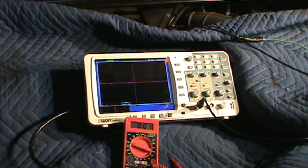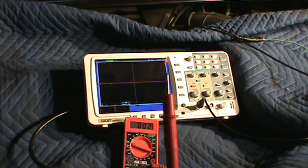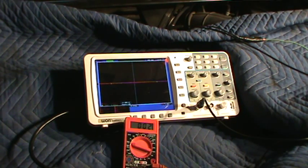That's basically ghost voltage. Hope you guys learned something and it cleared up a couple of things. This is something that confused me when I was first beginning with voltage testing — if I plug into a wire that's not connected to anything, how am I going to know it's actually a good ground? You can also hook up to battery positive and poke around with the other lead, but this ghost voltage test is something you've got to know, recognize, and understand. Thanks for watching — comment, rate, subscribe.